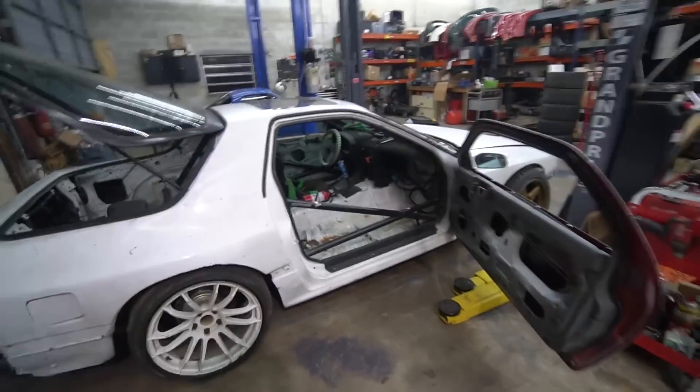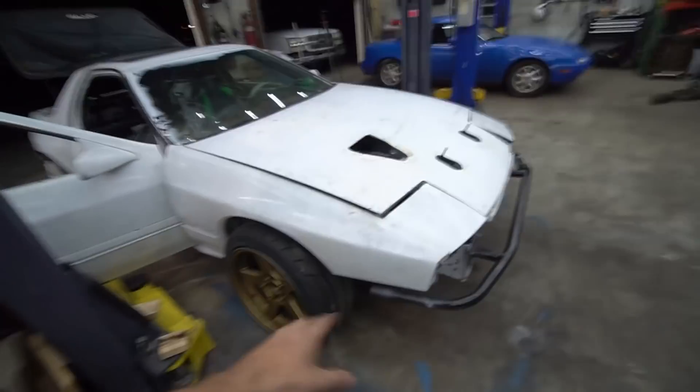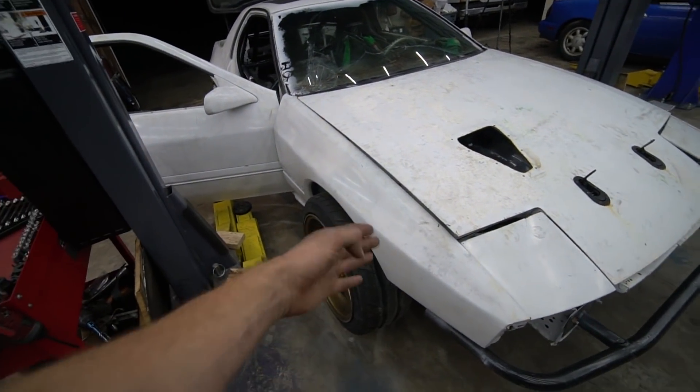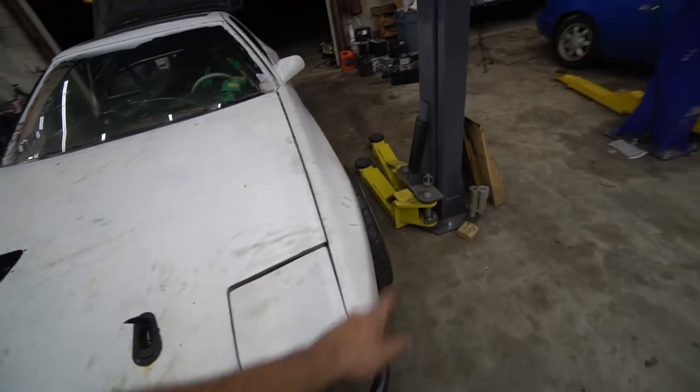The abandoned LSFC needs just a little bit more work to be fully sorted. We took it to the compound, found some issues, fixed some of them. One of them was front wheels were rubbing, put some spacers on, got clearance everywhere, and no more rubbing on the lower control arm. Put some new tires on that I had left over from the Miata, so that was good.